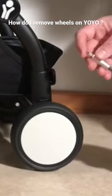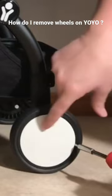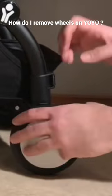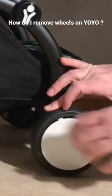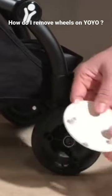You will need a flathead screwdriver that is relatively thin, and you want to get it under this lip — the white lip of this wall here on the back. You're going to just pop it, and once you get one of these pins off, you want to pull your way around to the next one and pop that as well. You want to do this carefully so those little pegs or pins don't break.